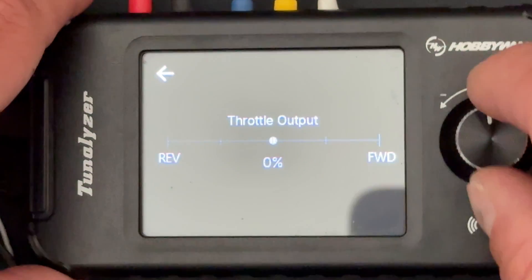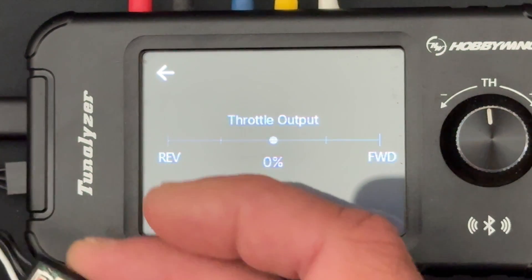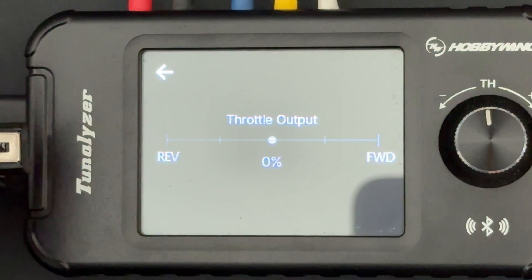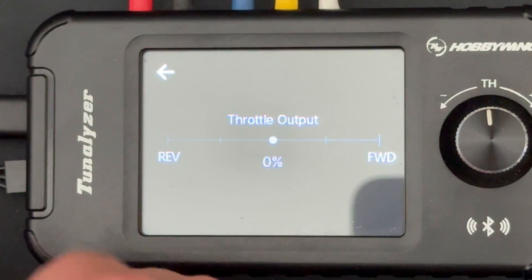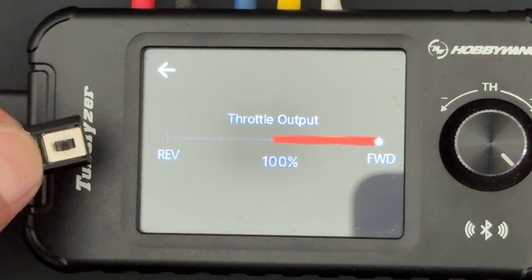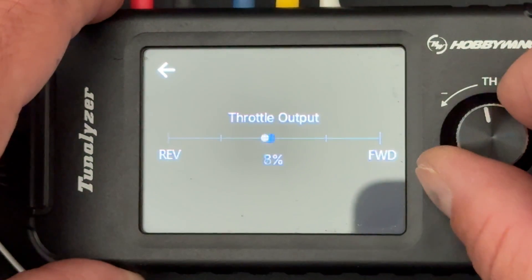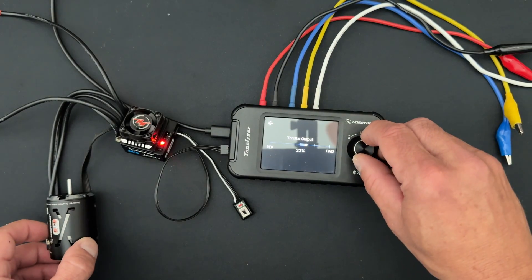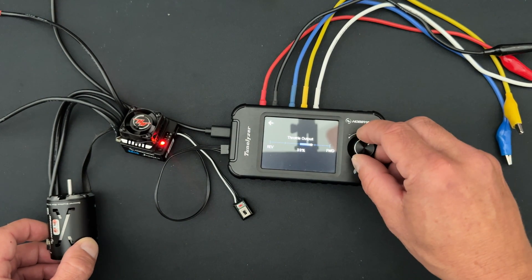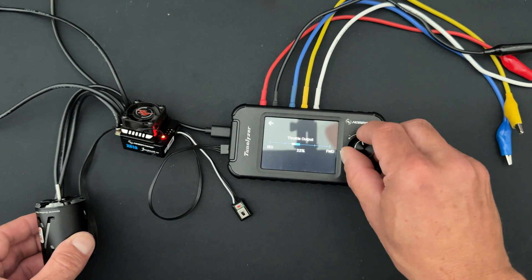We hit Enter to get in there, and you can see I can crank this up and down — it shows you the throttle output. I have a regular stock hookup here. To do the calibration process: hold the button down, turn it on, it starts to beep at you — tap it for neutral, go to full throttle and tap it again, it beeps twice, go to full reverse and tap it again, it beeps three times, and then it is calibrated. Once you get that going you can see it works just like your throttle does — you get blinking at neutral, a red light during partial throttle, and a solid green at full throttle with the motor running.